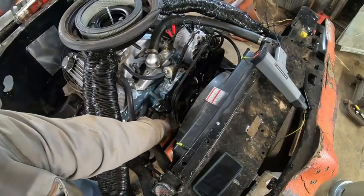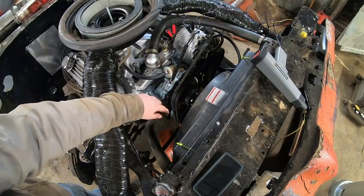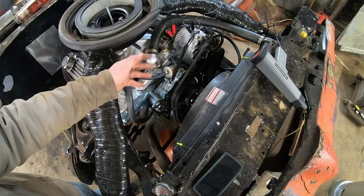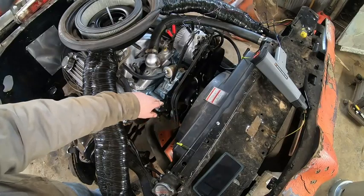You've got to look for your timing marks on a Pontiac — they're cast into the timing cover right there, it's real easy. They go down to like 12 or something like that. There will be a line cut in your balancer or damper, whatever kind of setup you've got, and that's the line you're looking at.